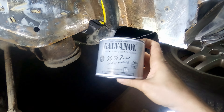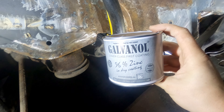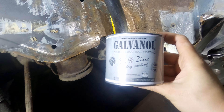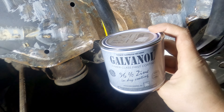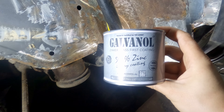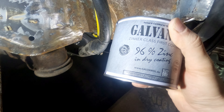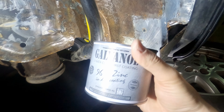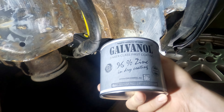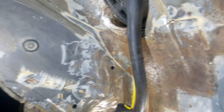Here's the interesting part — what I'm going to paint with. I decided to use zinc paint after talking to some local corrosion experts; they recommended scrubbing off the rust and using zinc paint. The paint isn't cheap — you can buy it in spray cans or in larger containers. I went with a half-liter bottle that weighs one kilogram because it's mostly zinc. The idea is that it will react with the rust and stop it from spreading into the body. In theory, the rust will transfer into the paint and get neutralized — we'll see how that goes.